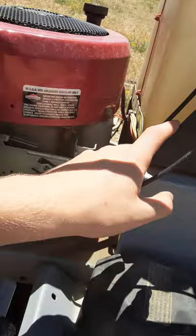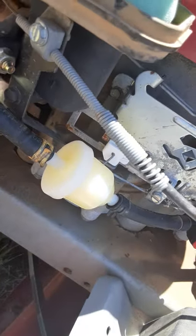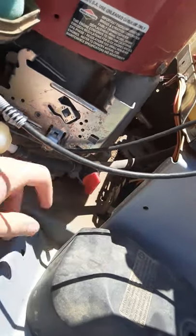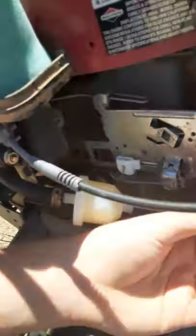This is a gravity-fed engine. What that means is gravity pulls the oil — or the fuel — through this line, through the fuel filter here, which I replaced, and into the engine. This here is a shut-off valve. What this does is it shuts off, or it doesn't let fuel pass, which makes cleanup and generally changing it out a lot easier.